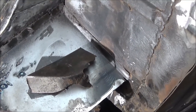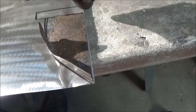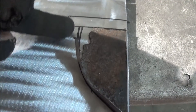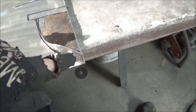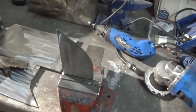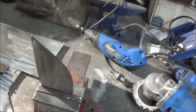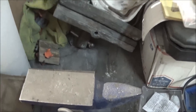So we'll go over to the bench and trace it out on some metal. Here's the first piece we've got traced out — it's the flat-sided piece. I've left a little bit of extra material on the bottom because I know I've got a gap to fill from where I cut it, so I can always grind down a little bit. Then we've got the fill-in piece where it's all rusted away — I've hand-drawn this over to where I believe the flange should be. This is going to have to be a flange that's bent over. So we'll cut it out shortly, and we'll get out the flat piece and bend it in the bench vise, hammer it flat, and finish it up on the anvil to make a nice 90-degree bend. Then we'll fit it up and see how we did.